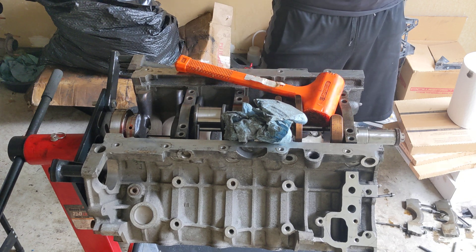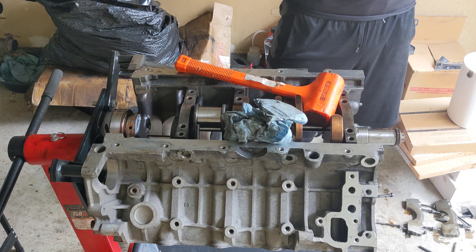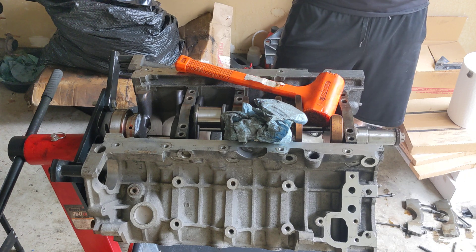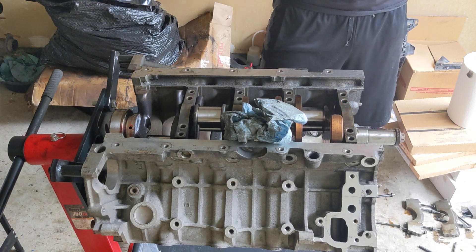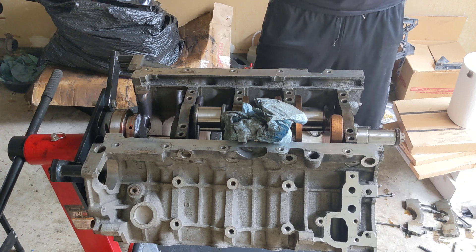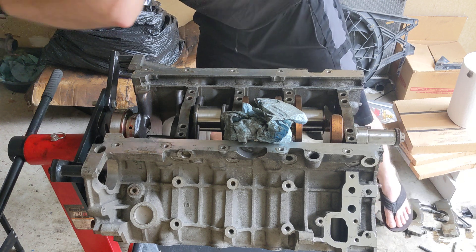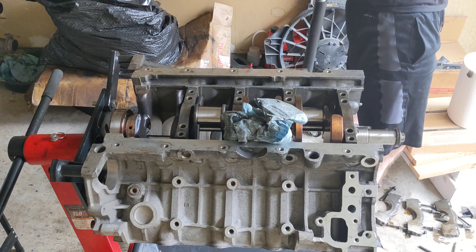Oh, this one wants to move. Kinda. Oh, it's moving. This one might be wiped. This thrust washer might need to be replaced. Hang on one sec — I'll show you guys if I can get it out. Crank's fine though. Let me wipe it down and see. We might need to buy bearings.